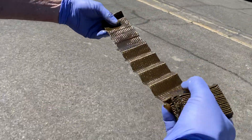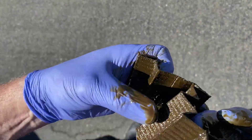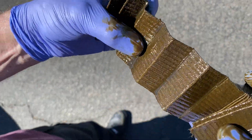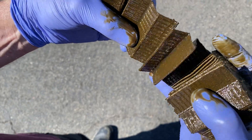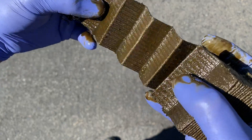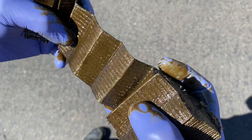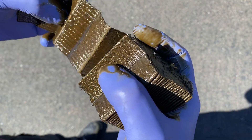We're going to take this outside to the sunlight. If you have super bright artificial light it'll work, but if you just come in here — see that piece of black stuff right there? That little black particle? That's a piece of steel, probably a piece of metal. It tends to gather in the bottom of these pleats, because that's where the return side is — it pushes it to the low point.